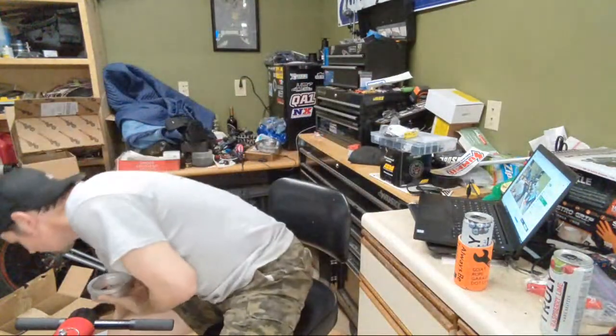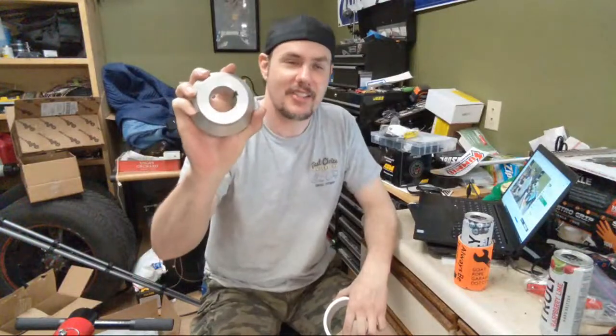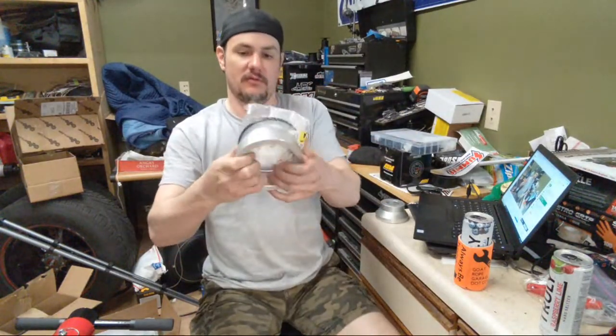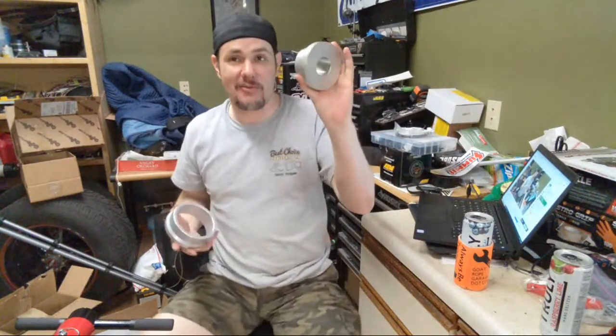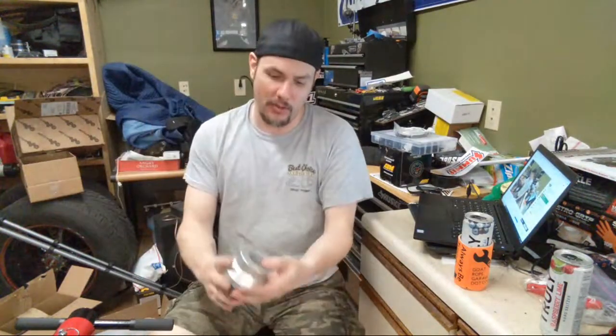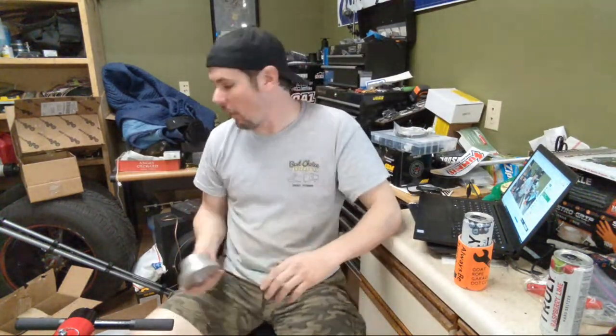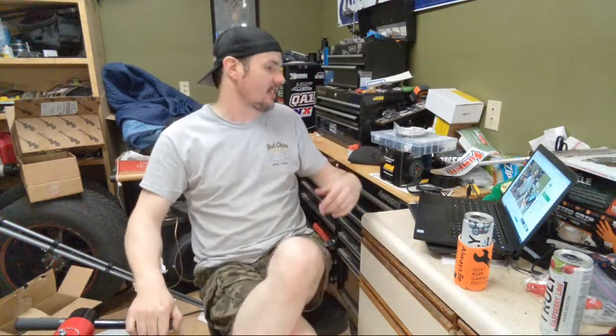These things are great. Front seal. These are actually designed to align your front and rear covers, and in turn, put seals on. It perfectly aligns to the seal. Bop that thing in there. And the front one's important. There's even one for doing your oil pan. The front one's important because if you just put the front plate on and bolt that thing down, you're going to wear that front seal out real quick, because you will find out the hard way that the top side of that seal is riding on your crank.